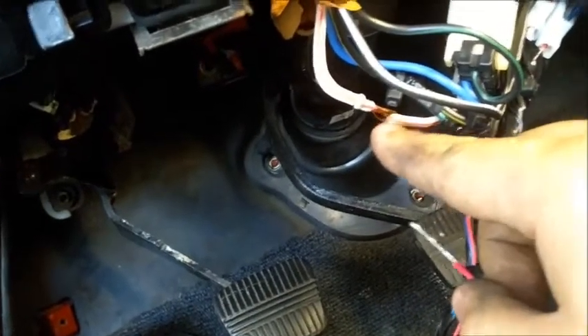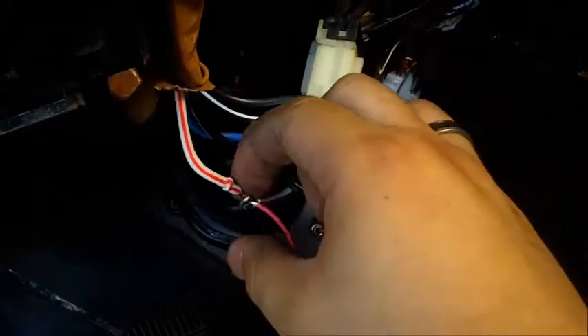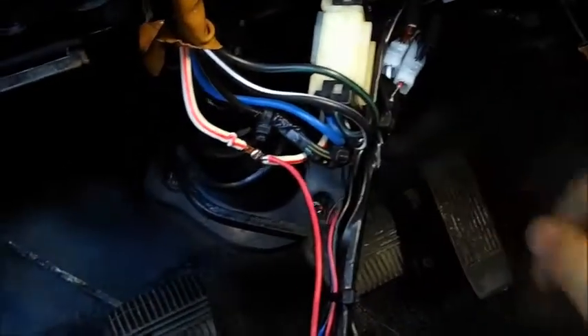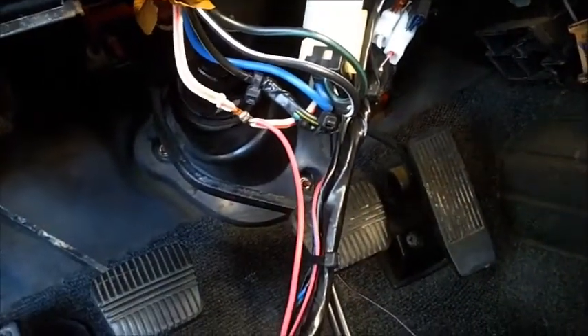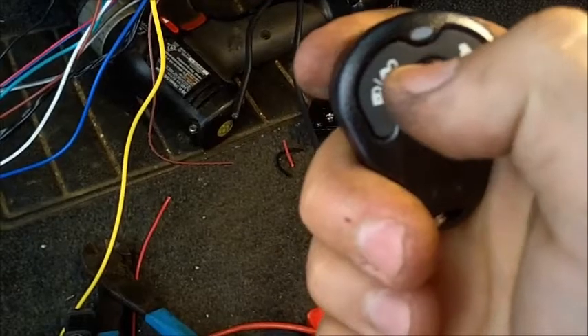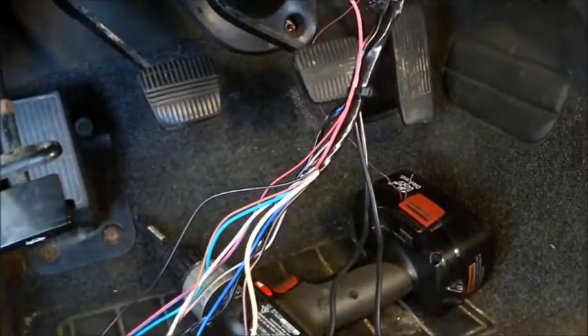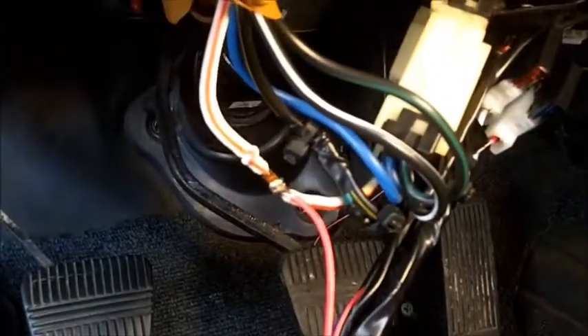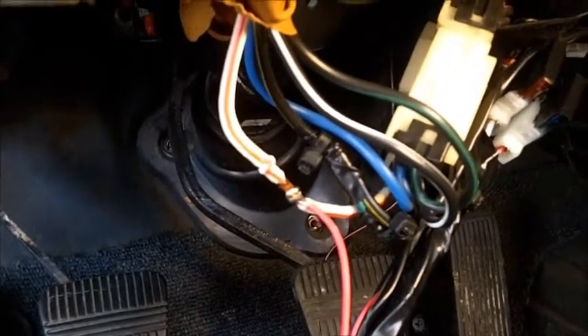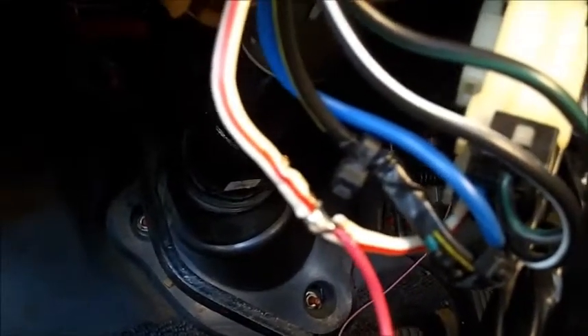I've stripped the wire, poked a hole through the middle, then wrapped it around — that's your poke and wrap method. Right now you can hear the alarm is going a little crazy, so I'm grabbing my remote to disarm it. Some guys like to leave it at poke and wrap, but I like to poke and wrap for the connection and then solder it as well. I went ahead and soldered that constant wire — it's nice and solid, no chance of that coming loose. Some guys and some shops are okay with just poke and wrap, but I prefer solder; it gives me better peace of mind.